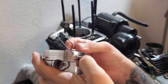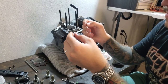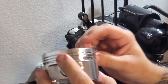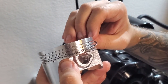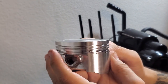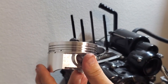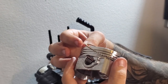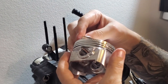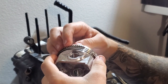We're going to start with the more difficult ones at the bottom. As a fair note: if you bend or break any of these, your job is over and you're ordering new piston rings — this especially being your very delicate one. Get your bottom ring started and just loop that around. They do have a little bit of pliability; inserting them this way is the easiest way to get the most pliability without bending or marring them.